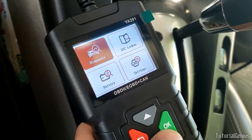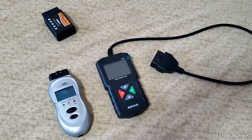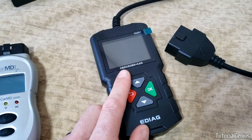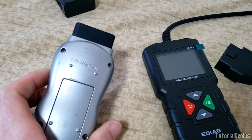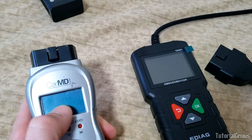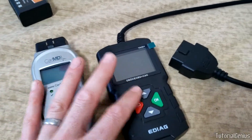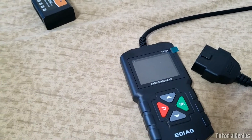We're back inside where it's cooler. Quite impressed with the features for $18. What do you get for less money? This $10 device here - the difference is it doesn't have a color screen, it's just text. It tells you I/M readiness for a smog check and can read generic trouble codes - pretty much everything this can do without the graphing and the DTC lookup.